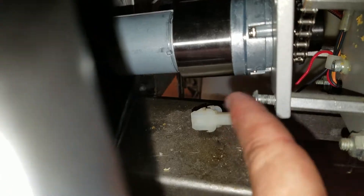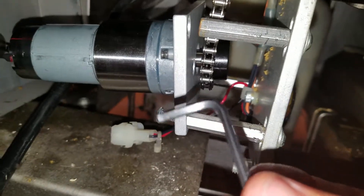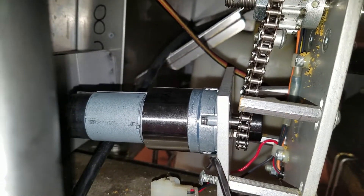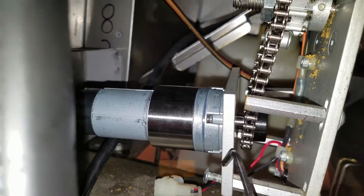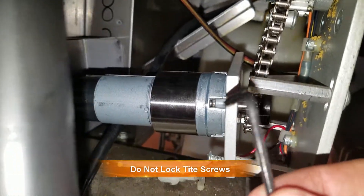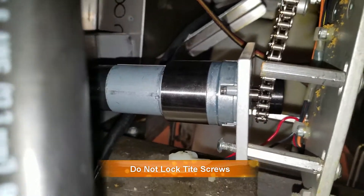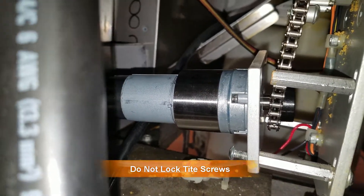The allen wrench you need here is a 1/8" allen wrench to remove those screws. These are the only screws I never loctite back in — they're just painful to strip. In fact, Henny Penny finally stopped loctiting these on their new units because they were causing such a problem — you had to cut them off, which was a big pain.